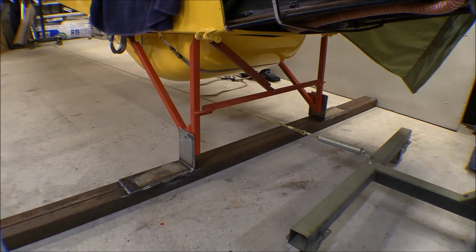The rudders rig pretty good the way it is — I set the swing on it — but we've got to rig the elevators and then rig the wings, get the right dihedral and everything. So we want the fuselage level side to side and front to back. This will be nice and stable to work on. The wheels on the bogey gear just aren't sturdy enough, and they're narrow gauge — they would have tipped with one wing on until the other was on, and probably past their weight limit anyway after adding a belly tank, paint, and everything else.